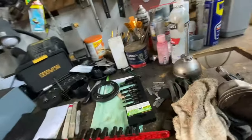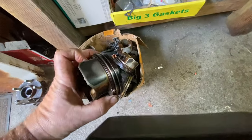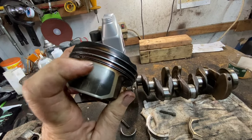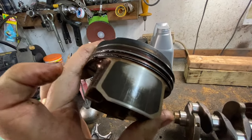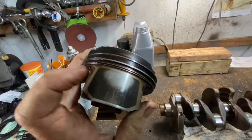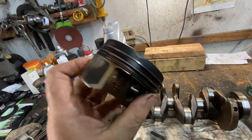let me show you a used one. See, all of these are pretty much all worn. This is just for demonstration. I keep these just to make the video. This one's not that bad, even though it's still worn. When it wears away, the black. But a lot of times they have fine little lines in there. And in the shiny area, if those fine little lines are still there and the piston is not scored, you can reuse it. You can clean out the piston oil control rings.